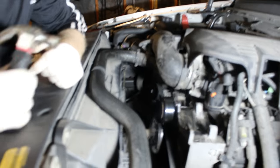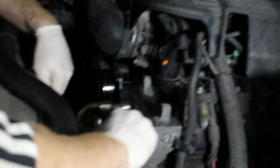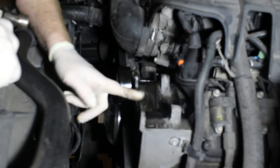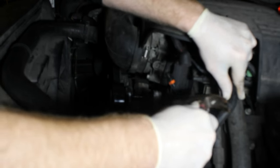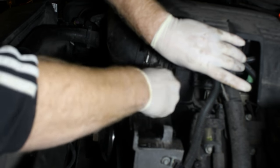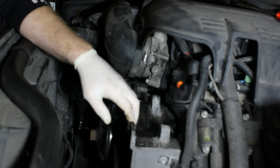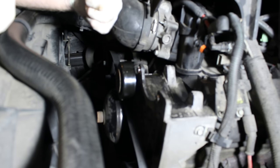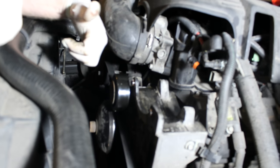That last attempt was a complete fail. Here's the bushings — as you see they'll kind of come in and out. The reason why this alternator was misaligned is these bushings were too far this way. So I just took this little stubby hammer and some PB Blaster, and now the bushings are all the way against the bracket on the engine. Now the alternator will sit further up and all the belts will be aligned.